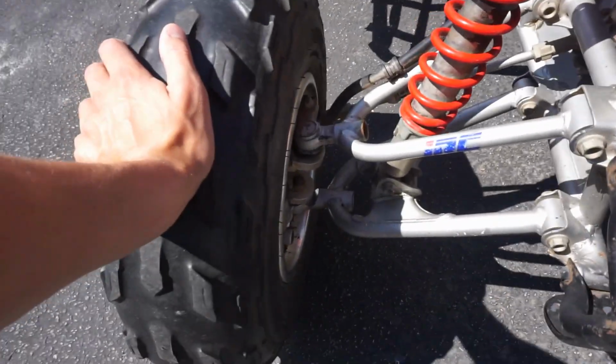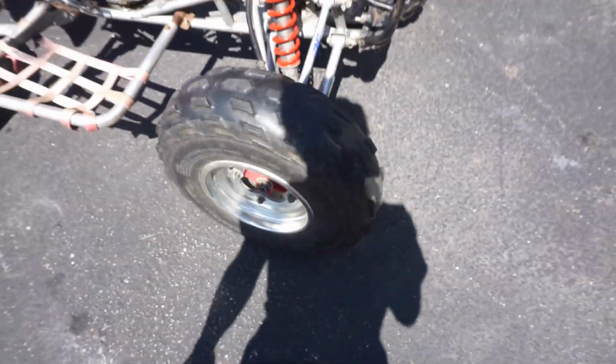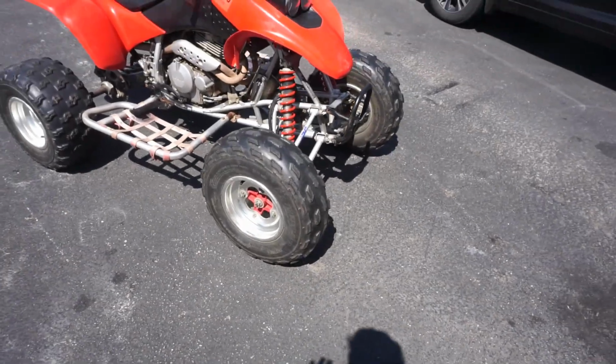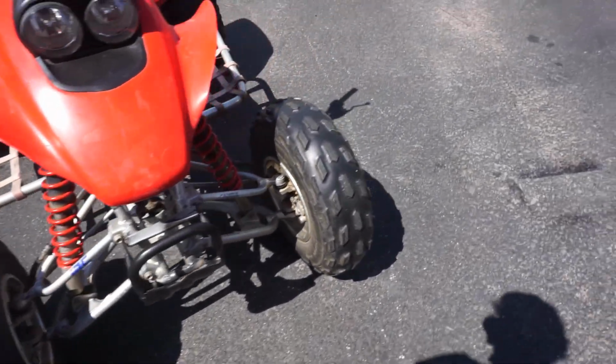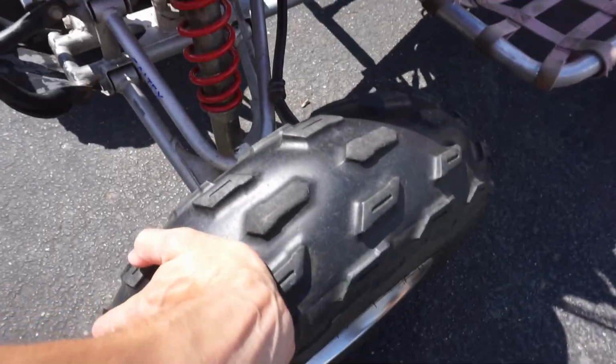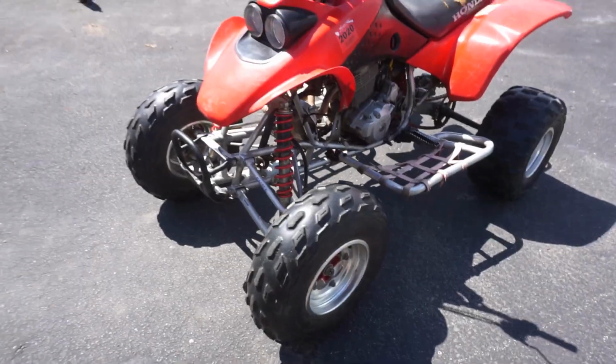As you know, it just wobbles like crazy. A bunch of comments said that the tires should not be 18 psi, that they should be around 4 or 5 psi. So maybe that's causing some wheel wobble. But yeah, we're gonna deflate the tires a little bit down to 4 and 5 psi and see if that helps. Also, people in the comment section were saying wheel bearings.